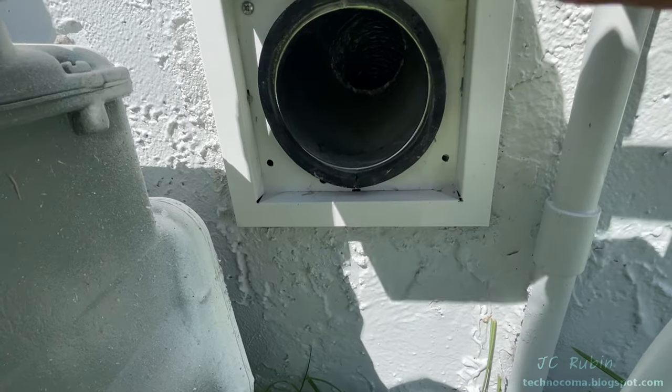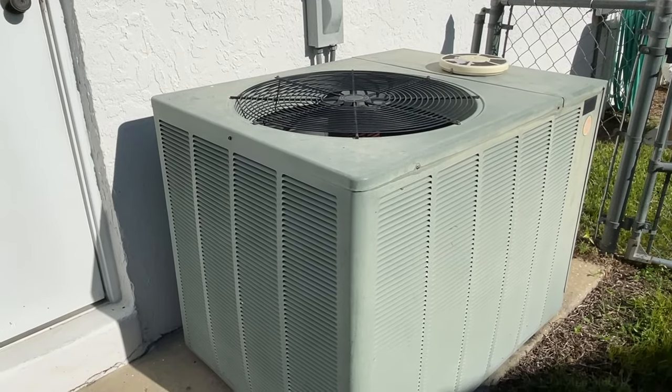That's because the ductwork all the way through to the back vent is around four inches. A heat pump operates like an air conditioning unit but in reverse. As such, the air in the drying cycle has to pass through multiple layers of really fine fins as part of its closed-loop drying circuit to remove moisture. If the filtration system is not perfect, those fins will fill up with lint.